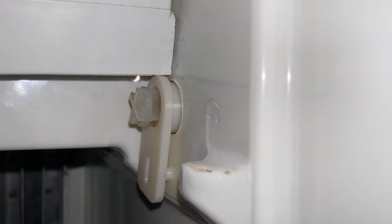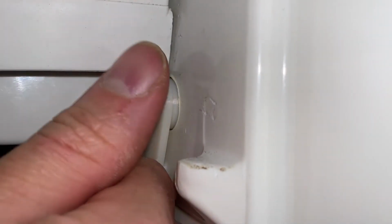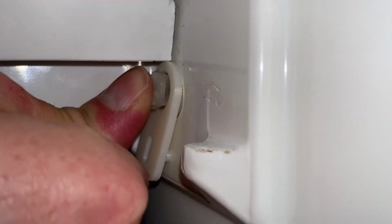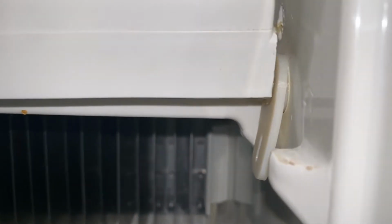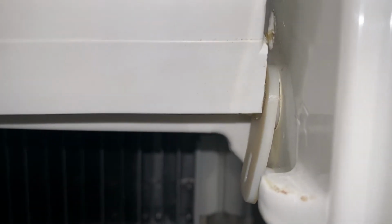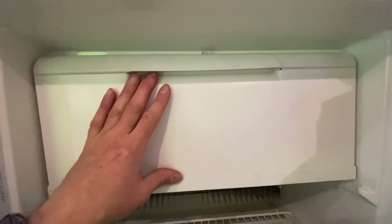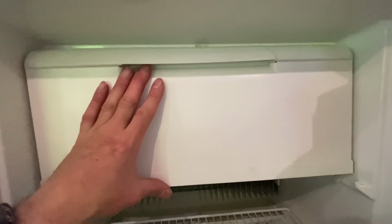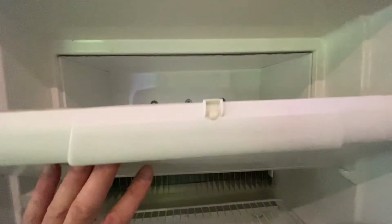Keep using the freezer door to put pressure on the left bolt while you depress the right bolt with your thumb or a tool. Gently position that right lower freezer corner until you feel the bolt receiver engage the bolt. You'll probably hear a little pop. At this point, the freezer door will actually be mounted on the hinge, but it will still fall open.